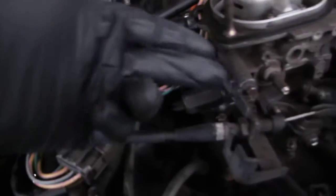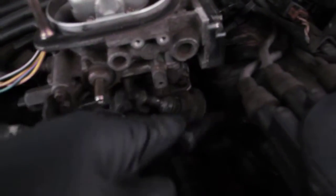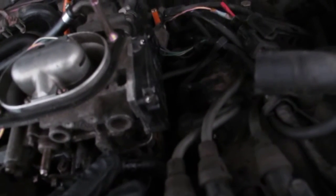I figure it was through these fast idle solenoids or whatever — coolant goes right through here and out the other side. It comes up through the intake manifold, right down there through this fitting right here. I cleaned everything out and blew it out with compressed air. We'll just have to see how it goes.